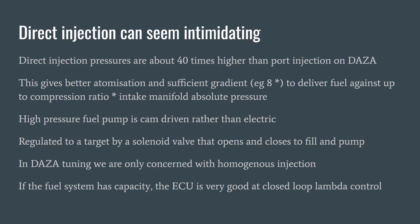The great thing with modern ECUs is that they run full-time closed loop lambda sensors that come on stream as quickly as 10 seconds after a cold start. If the fuel system has the capacity and you tell it what lambda you want at a particular load and RPM, you'll usually get it really quite well.